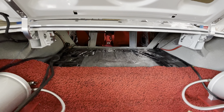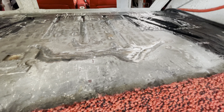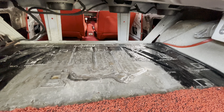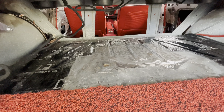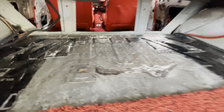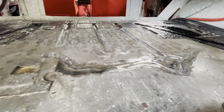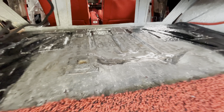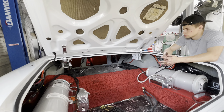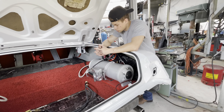This is the top side — you can see the pattern from the reinforcements and the big chunk that was missing right in the center. Before the plate it was all wavy too, so welding it up made it pretty flat as well. Now it's really reinforced so it shouldn't have any problems in the future. They're gonna put dynamat back over it — we didn't grind the welds down completely because it's gonna be covered anyway and it adds strength. You don't want to make it weak where it breaks again. So it's done — now it's gonna go off to get the trim put back on and the glass.